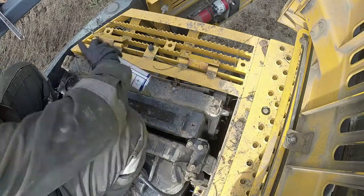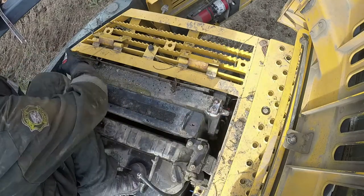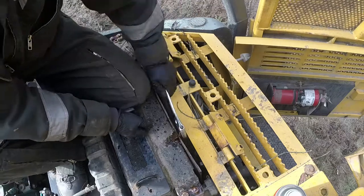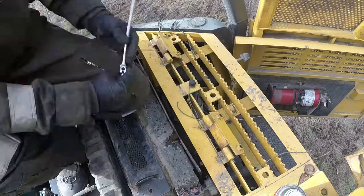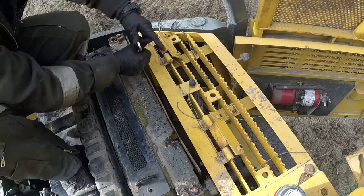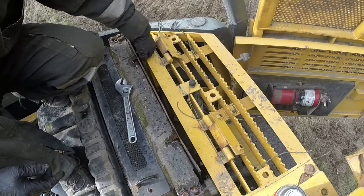There are four bolts to undo for the oil cooler cover plate. We're getting to the outside part of the assembly. We need to remove the plate — there is actually a bug screen at the front. Remove that part and pull that screen out. We need to get that first before we can start working on the oil cooler side.